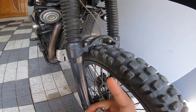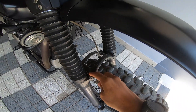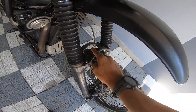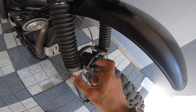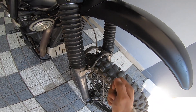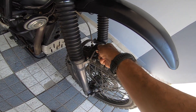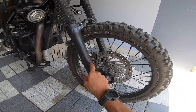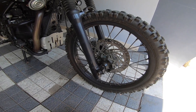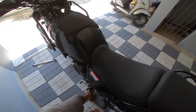One more thing I forgot: try to remove the fork stabilizer as well. It's a size 4 or 5 Allen key — four bolts. Remove the steering stabilizer completely. This is important to achieve perfectly parallel fork legs with zero degree of tilt, twist, or warp. So at this point you should have: the caliper removed and hanging, all lower triple clamp bolts loosened, and the fork stabilizer removed.